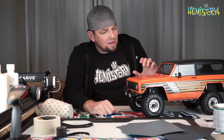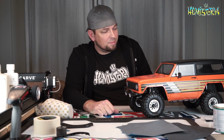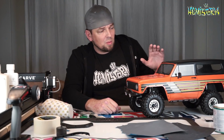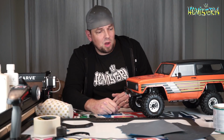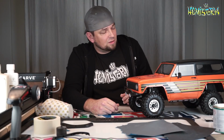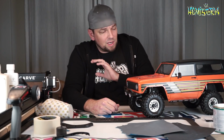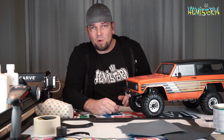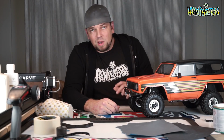Now in this case I had actually a lot of black going on the outside. I have not just the stripes over the side, but also the entire roof, some window trim, the International Harvester logo that is on the hood, and plenty of other little details. So I made sure that I masked absolutely everything that I wanted to detail before I pulled out a can of black, and I gave it a first coat.